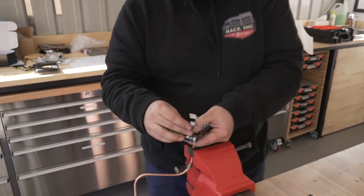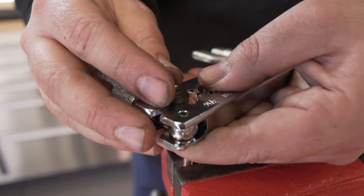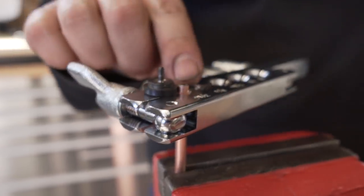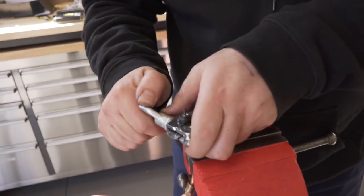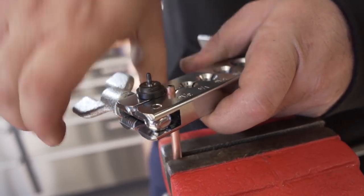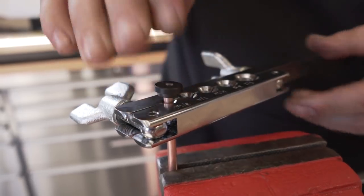And then what I do is I use this. So this is a double flare. So then I poke that through the height of that. Yeah, so sit that flush on there and go the same height as that. All right. Clamp her on down, pretty tight, because it'll spin or it'll push it down. Right, and then this simply goes in like that.